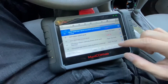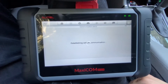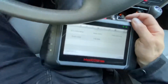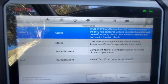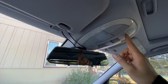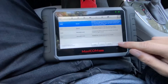Go down to the next one — overhead control panel. You can see it's pretty quick, blinks up at the top here indicating that it's working. It's got the connection indicator and your power button here; long hold to turn it on, just tap it to turn on and off. Read codes. Here we got some tilting roof stored — don't worry about that. It says current and stored front dome lamp. As you can see, my front dome lamps are LED; I swapped those out for LEDs. So it's probably what it's complaining about, but they're working fine, so I'm just going to ignore those.